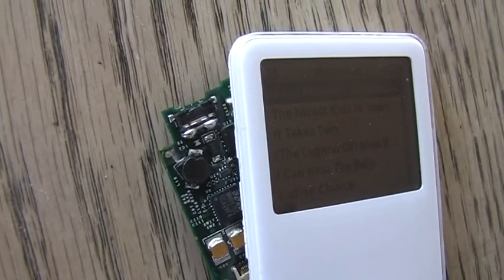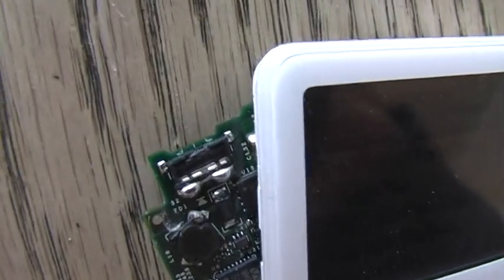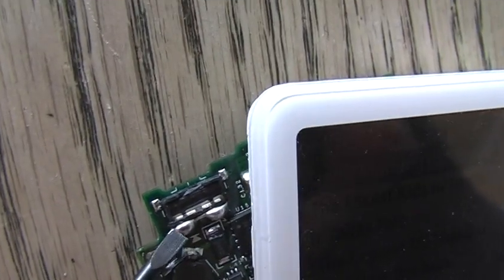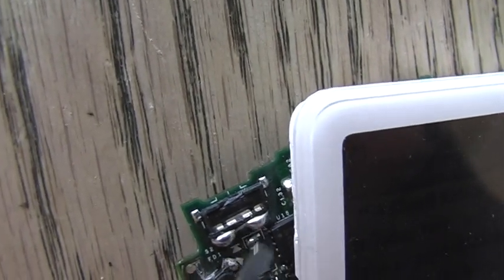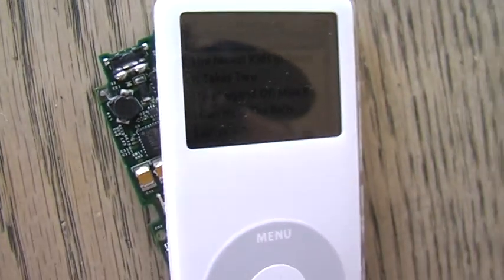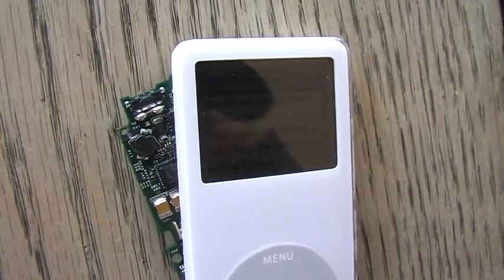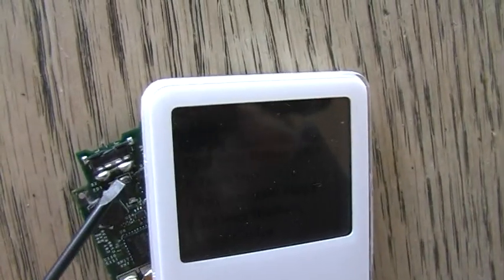Here they are apart — they don't come completely apart, but if you pull them a bit away, you can get to the top left-hand part of the circuit board. You'll see a pair of two solder drops — the large ones are mine. There's a small wire between two silver points just under the black plastic piece. If you bridge those two points with a piece of wire and solder it in place, you'll turn that switch permanently off so it doesn't lock anymore.